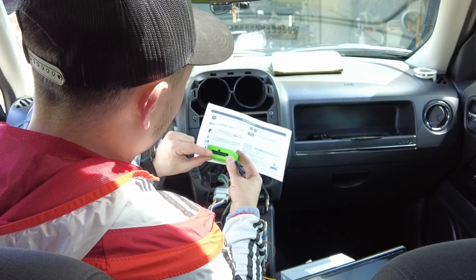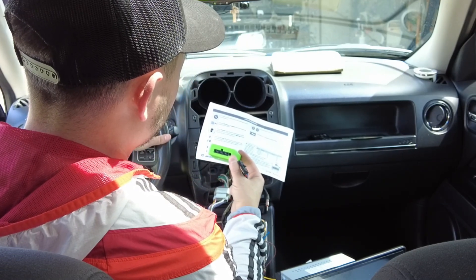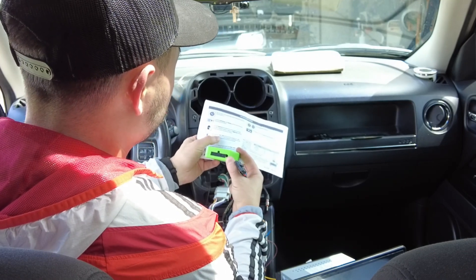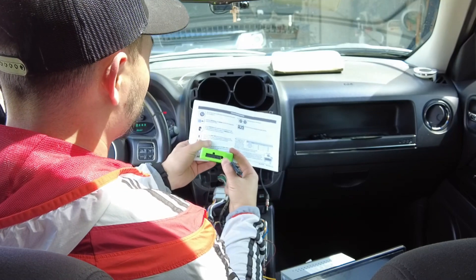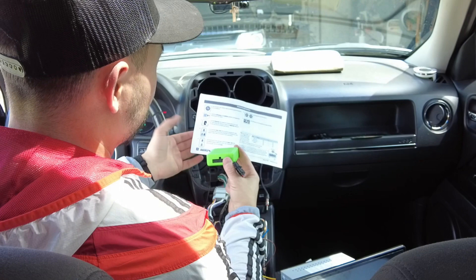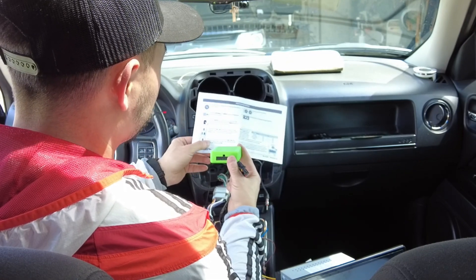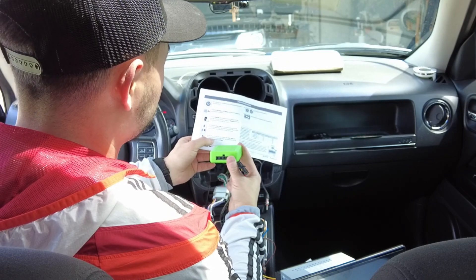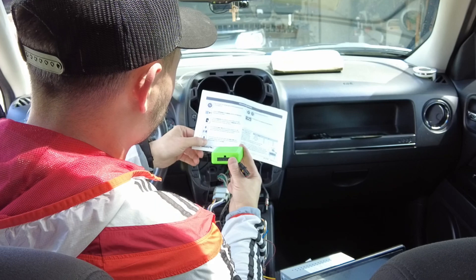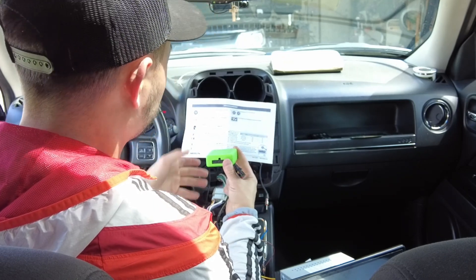The LED is down at the bottom left corner — it's going to be flashing once you plug this in, so keep pressing the volume up button until the LED stops flashing. The LED will flash green and red while the interface programs the radio to the steering control. Once that's programmed, the LED will go out and produce a pattern identifying the radio type installed. Then it will automatically flash green and red again while the interface programs itself to the vehicle. Once programmed, the LED will turn solid green — then turn the ignition off, back on, and test the function.